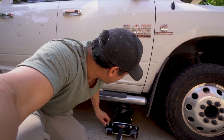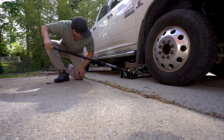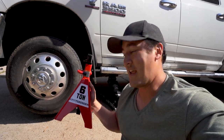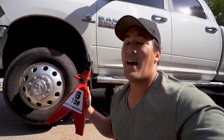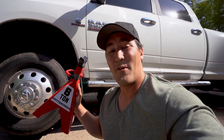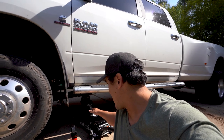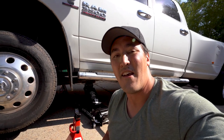I've got the jack underneath the truck right now and I'm going to jack this thing up. We found a solid, secure place underneath the frame to use to jack the truck up. Once you've got the truck jacked up, you need to get these jack stands — these are six-ton jack stands. I've got one six-ton jack stand on each side of the front. That's a little bit overkill, but I just want the security of knowing I'll be as safe as possible while getting underneath the front of this heavy truck. Place the jack stand as close to the place that you've jacked the truck up as possible, and make sure there's enough height for clearance to get underneath.